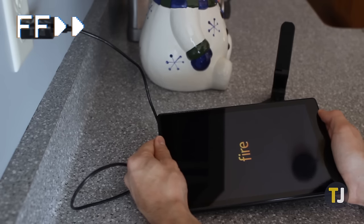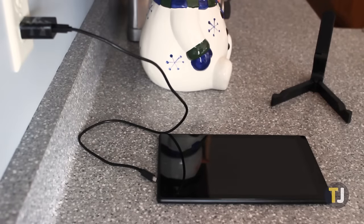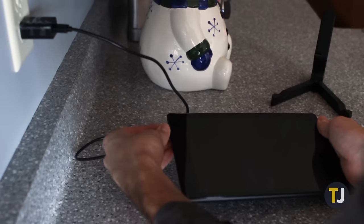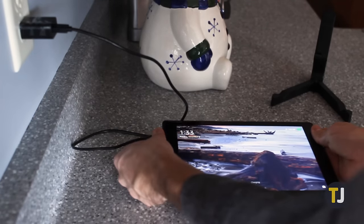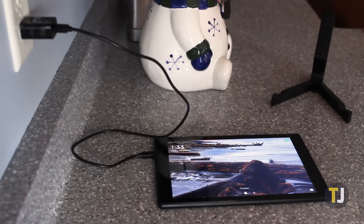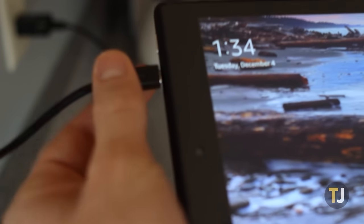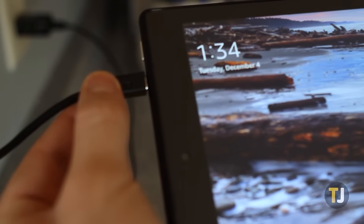If you're still unable to charge, you may have run into a hardware issue. Fire tablets are well built, but faulty micro USB connectors have been a common problem among consumers, especially on older models. Plug your Fire tablet in with both the device and the cable lying flat on a hard surface. Slowly move the cable up, down, and to the sides of the port to see if the connection re-syncs. As we mentioned, micro USB has its fair share of problems when it comes to reliability — it's why the move to USB-C has been so popular.